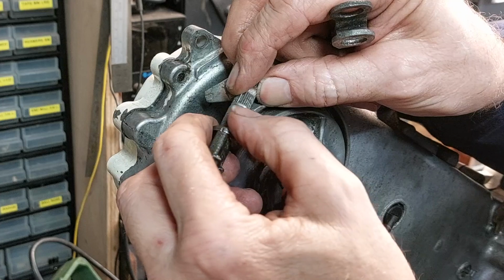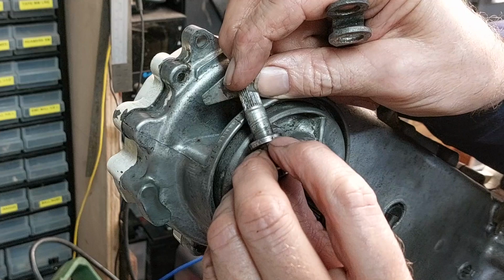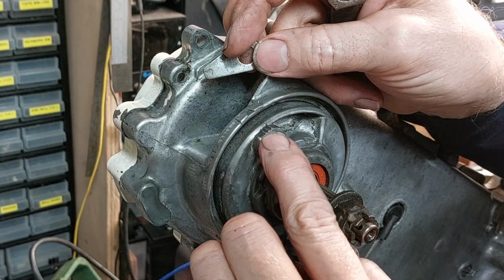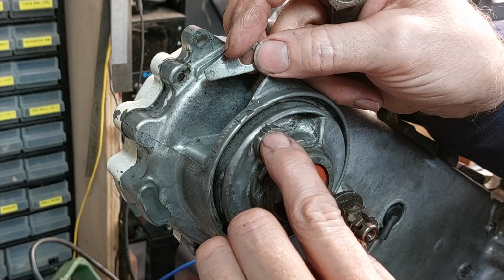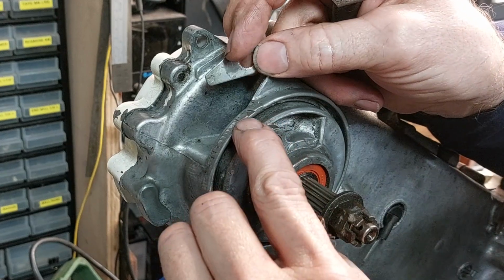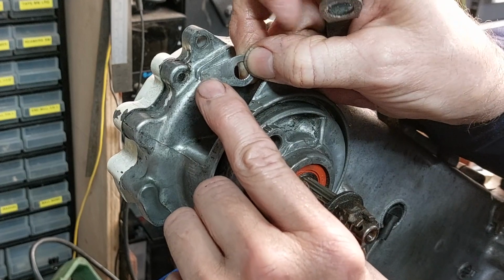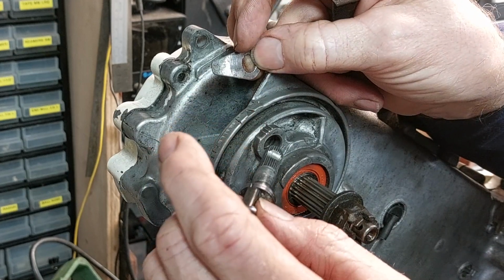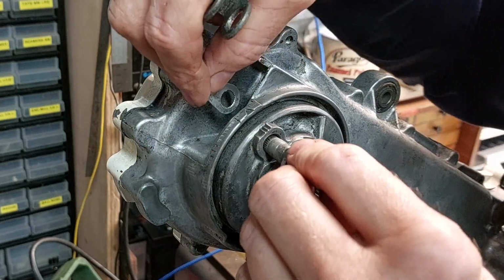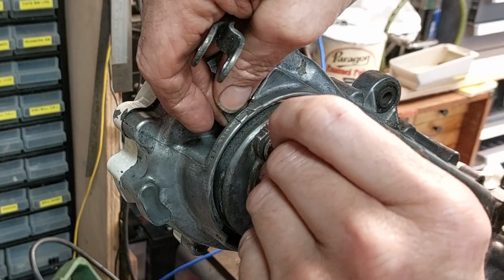Okay, it's got a scroll through it, a bit of grease to sit in, and then it also has a little pip on it which coincides with these 3 marks on here. So 3 marks there, and then there's that arrow there, if you can see it. That arrow is for this indicator here, when you've reached the maximum shoe wear. Okay, so I'll do a dry run for you and show you. So see if I can do it with the camera in the way. That goes on there, like that.